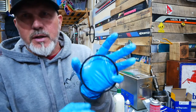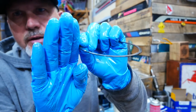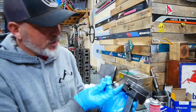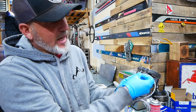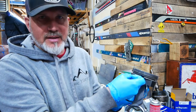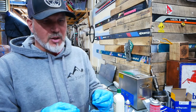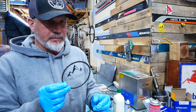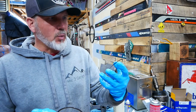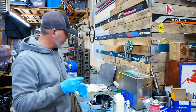You'll notice right there there's a dimple on top — it sticks out just a little bit, but it's enough that when you put it into the ring groove, that dimple falls into the gap and keeps the spacer from moving back and forth; it will run up against one side and stay there so it won't ever collapse. These are about $3 apiece and worth every penny. The stuff that comes with Speedmaster is just crap, and I am glad that I noticed it before I assembled the motor.